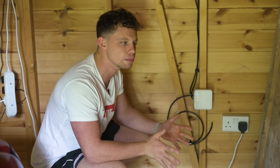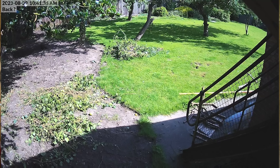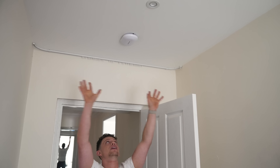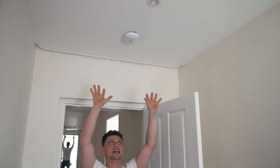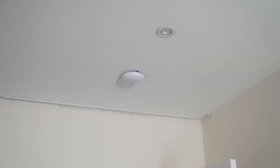You may be thinking, why have I got so many cameras in the garden? Honestly, it's only so I can keep an eye on my dog. This is my downstairs access point — it's right in the corridor and it basically covers the entire downstairs portion of my house in five gigahertz Wi-Fi. If you're trying to design a Wi-Fi network, do not rely on 2.4 gigahertz because it will let you down. If you've got five gigahertz coverage everywhere, that is the way to go.